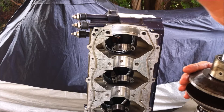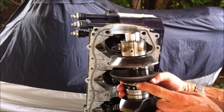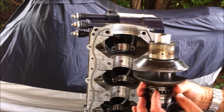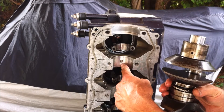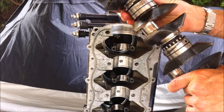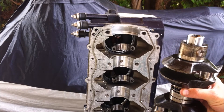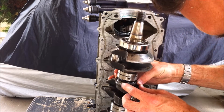Right here is the crankshaft sealing ring — it's got an end gap right there. When I put it in, I'm going to face this opening end gap into this edge here. It's hanging loose but it fits into that slot. I'm going to make sure it fits and position it facing back towards the crankshaft half.